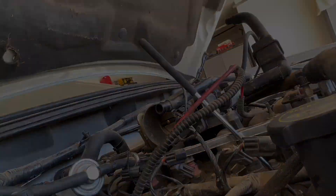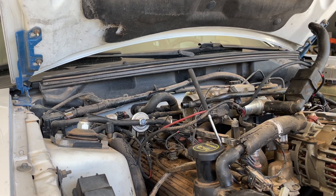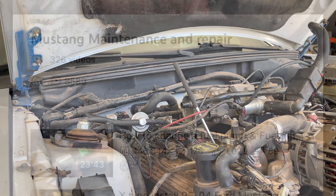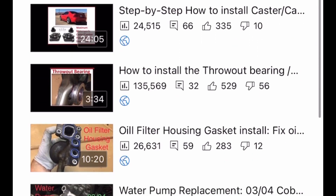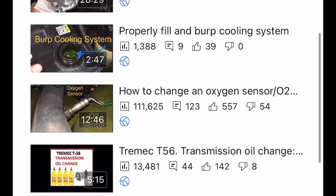Anyway, that's just one of the many simple ways you can check for top dead center. This is for cylinder number one. On the 96 to 04 Mustangs, at least, cylinder number one is on the passenger side front, and that bank is cylinders one through four. The other side would be five through eight. Thanks for watching — hopefully you enjoyed the video. Please check my playlist in the video description for more videos like this, and if you're new to the channel, feel free to subscribe.